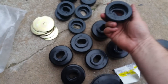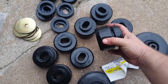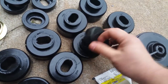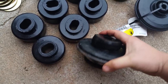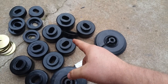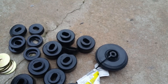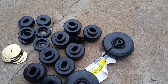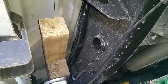I'm going to use two hydraulic mounts on the rear, then two of the polyurethane for the front. The pieces go on the underside just like that — see how they go in there. They actually fit these two, so I'm going to use the pieces from the polyurethane on the bottom side and the big mounts on top, and the bolt goes through it. There are the plates.